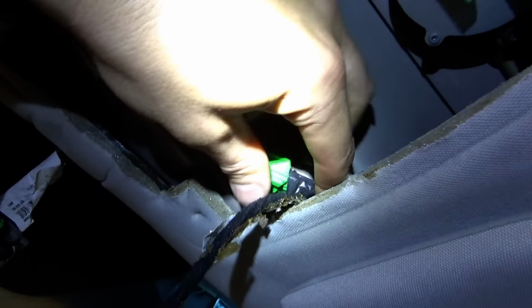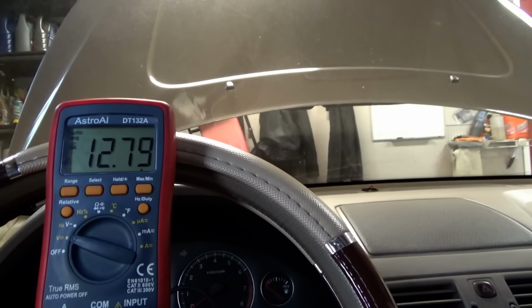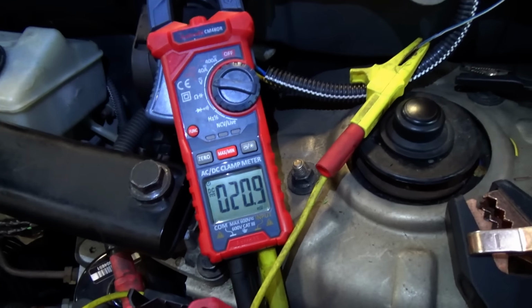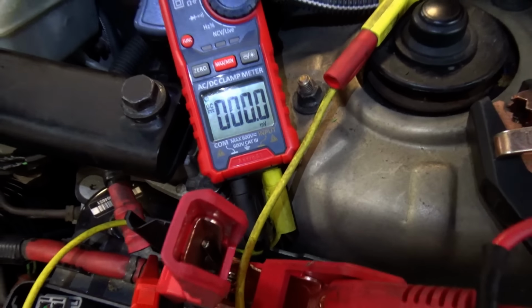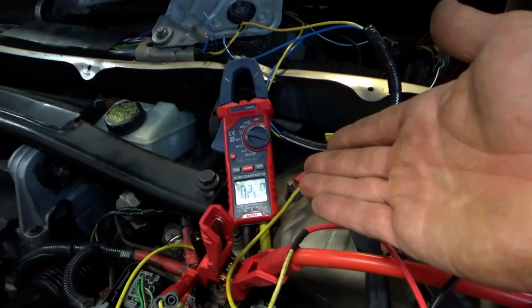What about on this side? Water leaks, they kind of start going down both pillars here. I don't know if the headliner was replaced. This car is very questionable. But something changed, and now we have high voltage, proper voltage, on that circuit. And let's see, I assume the voltage on our park circuit returned, if we tweak that connector to establish contact again, at 11.1. So if I can fix this, and for 11.1, I think the wipers should start working again.